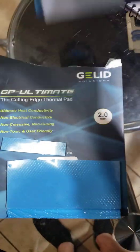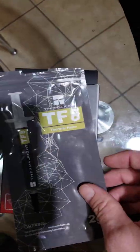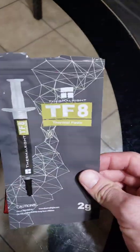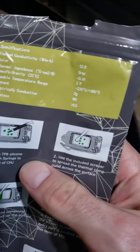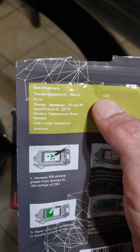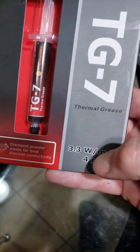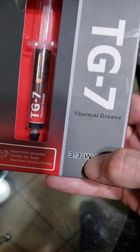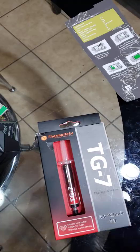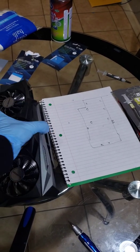However, I'm going to show you that 3mm are way too thick — 2mm is actually what you're supposed to use. I chose Thermalright TF8 thermal paste because it has a thermal conductivity of 13.8 W/mK, way higher than what goes on most CPUs. The stock thermal paste only has 3.3 — garbage.